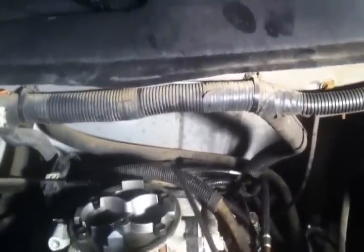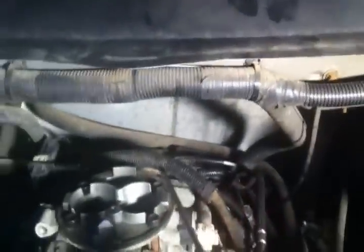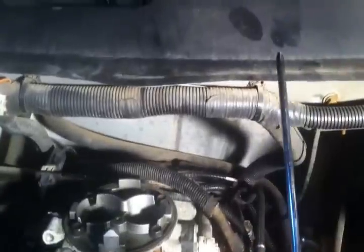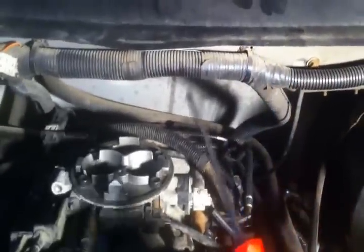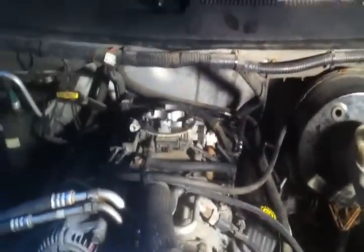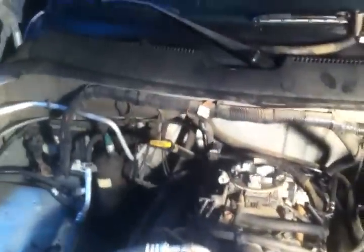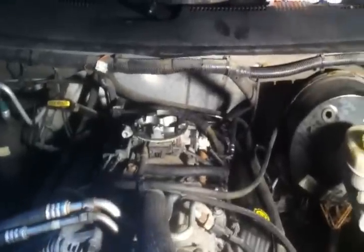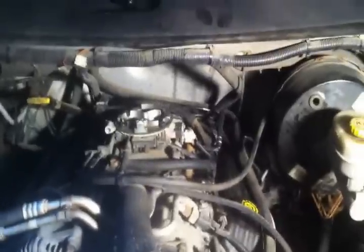you know? Once you got all them wires ran, then you bring in the new distributor cap and set it right in front of the old one, and you just transfer the wires right over to that one, right? That's a nice, easy, clean way of doing it, too. And that's the way I forgot about, when I started getting in here to start wrenching, those little things like that kind of come back to you. And that's the way I'm going to do this one, because I think that's the way I did my last one. And I just like the way it goes. Just nice and neat, and you can't screw it up.